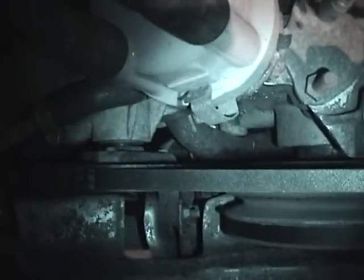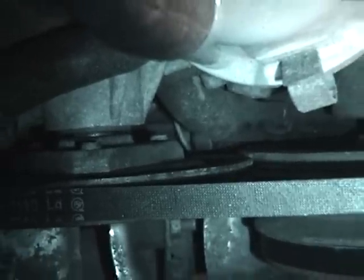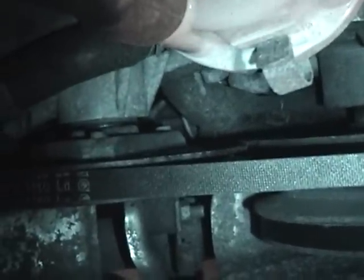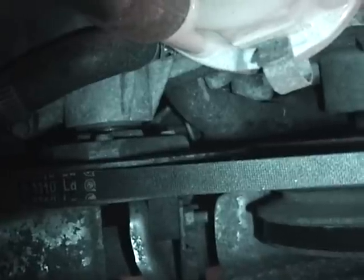I'm sort of aiming at it right here. Let me see if I can focus on it. Yeah, you can sort of see the connector straight down there. It's hard to make out the color of the wire because I have this on night shot right now — it's dark out here. It's early September and getting significantly darker earlier. This switch right down here, where you see that wire and that connector kind of below this metal tube and behind the belts and the water pump pulley — that is the high pressure switch.